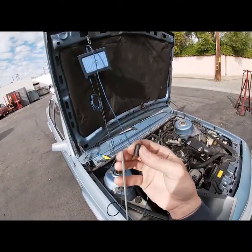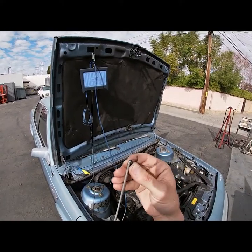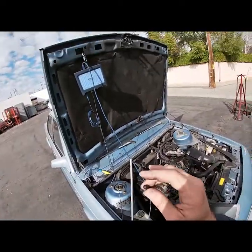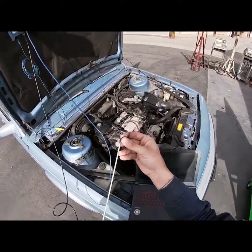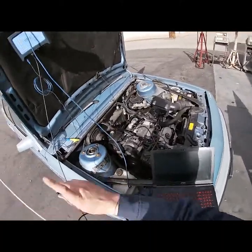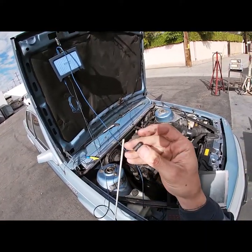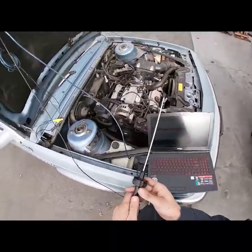I will add that this little rubber vacuum nipple tore and the probe is sticking through it a little bit. So I'm experimenting with it and without it. The noise seems pretty stable, consistent with or without it, it's pretty much the same. But what I'm noticing is without it, I'm on the pulley and I'm just slipping off all day long. But this thing is kind of just stuck on there a little bit. So that's pretty much the only tip I can give for this guy. If you're slipping off, put a little rubber vacuum nipple on it.